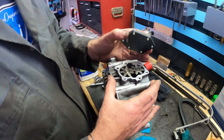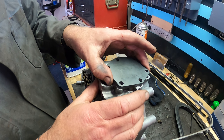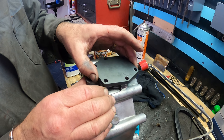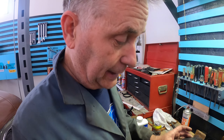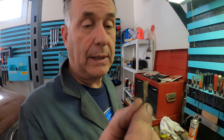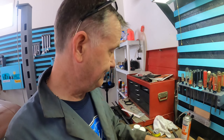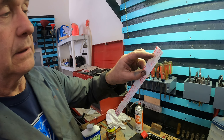This is the oil pump plate. What's really important is the clearance between this bottom plate that forms the bottom of the oil pump and this gear. I need to measure that clearance, and I have a bunch of different gasket thicknesses. I tried my best to measure the old gasket with my micrometer, and now I'm going to use a thing called plastigage.